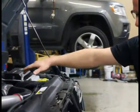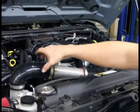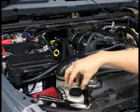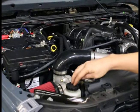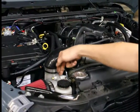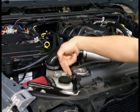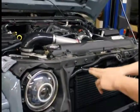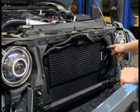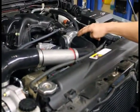So the first thing we're going to do — we've already got our Stage 1 installed on this vehicle — we're going to remove the short pipe altogether, remove the air filter, disconnect the power steering reservoir. All that's going to happen here is we're going to rotate the turbocharger compressor housing in the downward direction so the outlet points towards the vehicle. We'll be adding a hose here, a front mount intercooler across here, with a 90-degree bend, feeding back up and connecting to our throttle body on this side.